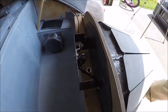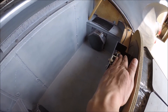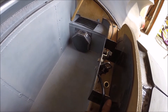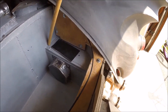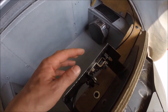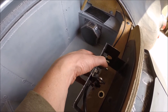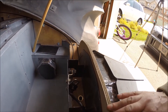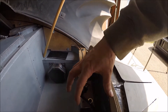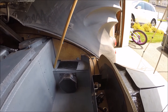Looking down in here we have the striker. When I first had it, I only had it this wide, but that wasn't giving me enough angle to come in and get clearance on the back of the lip. So I created a couple of little extender pieces that come across here. This is just the wiring to let me know that the trunk is open or closed. We can see the cable running back and up — when it pulls, the cable pops that little cancel latch that we saw and opens everything up. This stuff will all end up being fiberglassed, and I'll have a nice trim piece that covers it all, just opening up enough for the latch to come down in.